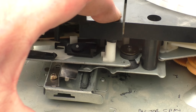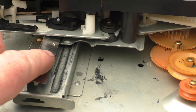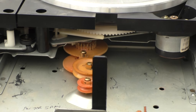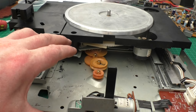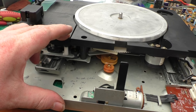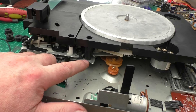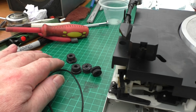The tray was catching about partway through travel - if you just slightly lifted on it, it could carry on in and out. So if you're having an issue where the turntable is only coming in partway and stopping, just check how much play you've got in this. You should be roughly flush with these areas, and if it's very low it means these rubbers have worn. I've bodged it for now with my plumbing kit until I can source some or make some.